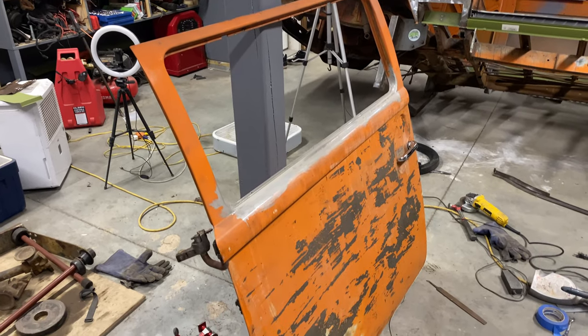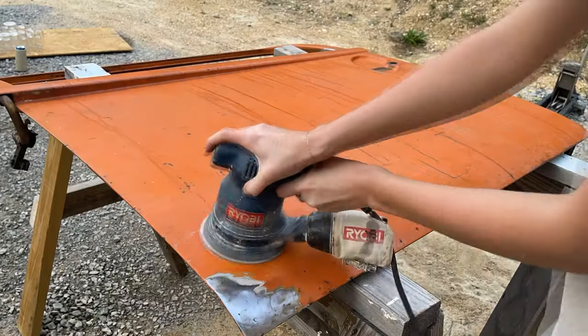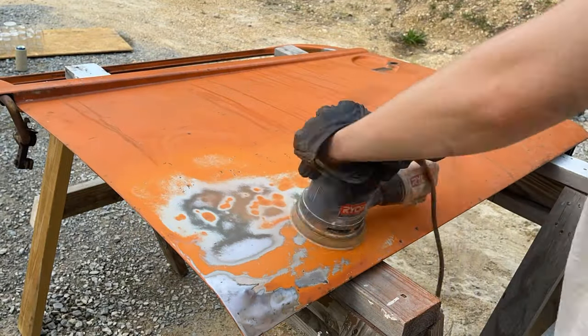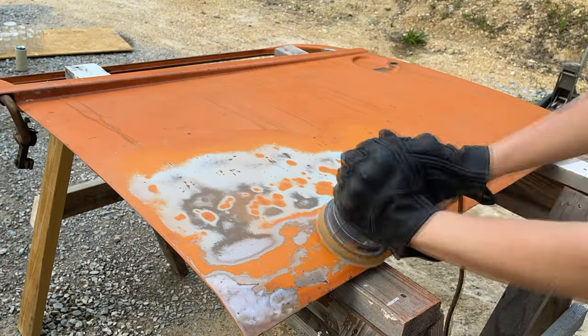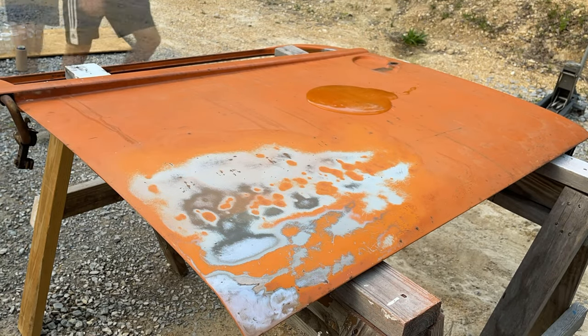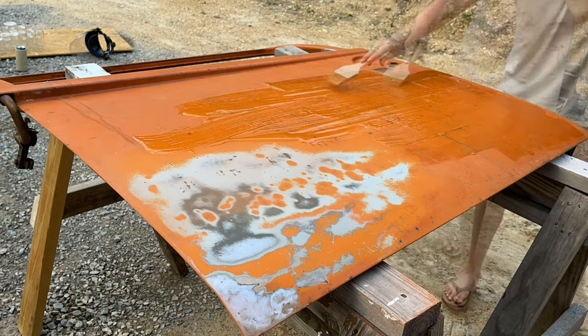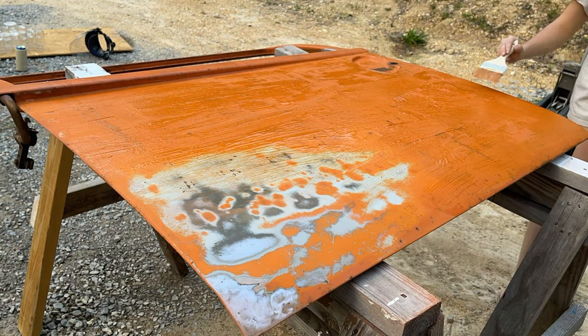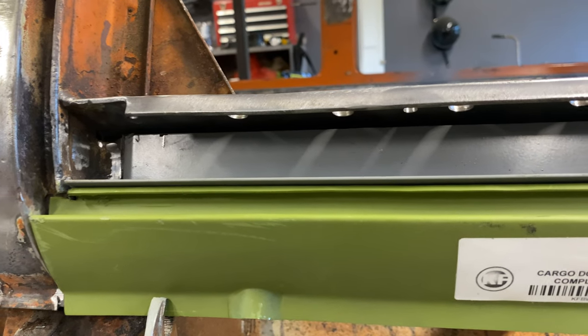As you can see, the door does look a little wacky — that is because Mallory and I tried to strip the paint off using that aircraft stripper stuff, but the new environmentally friendly recipe doesn't really work. Can't recommend it, don't do it. We're gonna have to grind all this off to fresh metal.